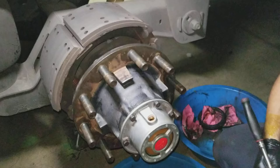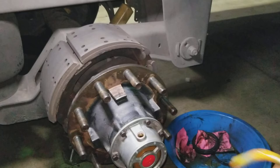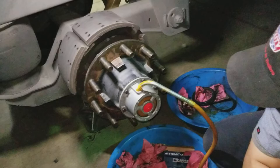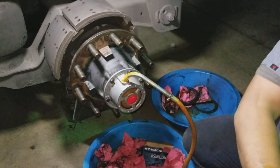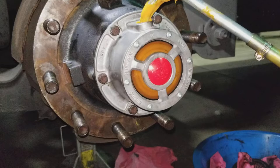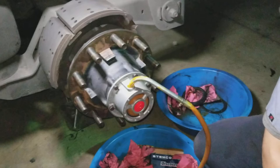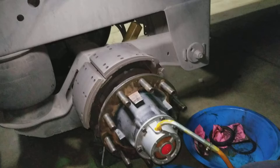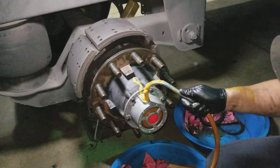You're going to grab your semi-fluid again, drop your hook in there and just start pumping away — you'll know when it gets full. You also want to consider when you're doing this if you're using the right type of cap. If you're going to be doing a hub with semi-fluid, you want a cap that has vent holes, so it breathes a little better than the little rubber caps. Because if you use a little rubber cap, it isn't going to be able to breathe right and you'll blow seals. But if you use this kind of cap on a hub with oil, that's going to let too much moisture in and your oil is going to get contaminated and you'll blow a bearing. Now we've got grease coming out of there, so you know it's good.